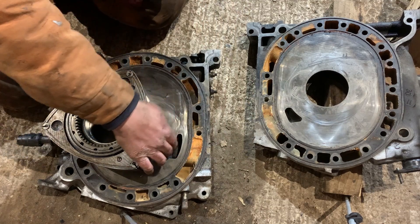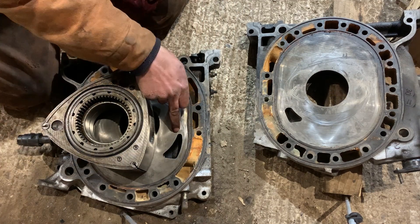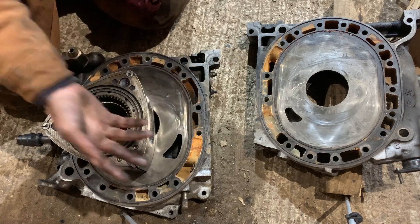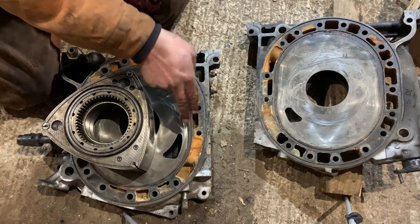Hence why this side is actually larger than this bit. For my ports, I did open up here to increase airflow, but it wasn't actually drastic enough to ruin anything. It will add more of a brappy idle though.